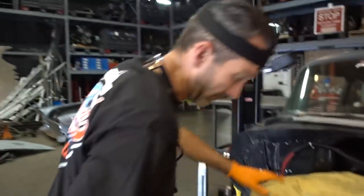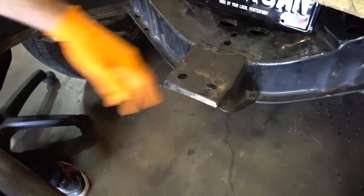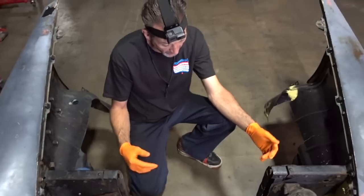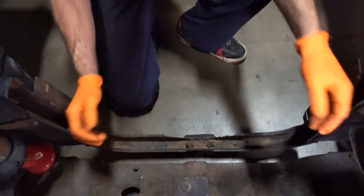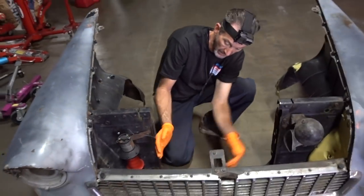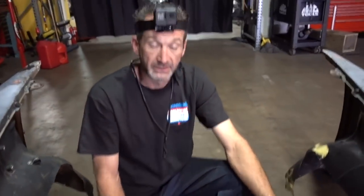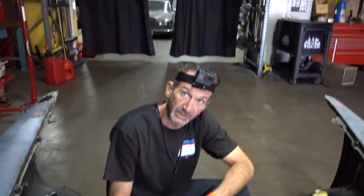So what are you doing first? Tying in the frame rails. The radiator support is going to basically go centered on these bolts. If we go over to the clip, we can walk over here and look at it. Before, the radiator was mounted on this side of those two centering bolts — these two bolts here are the two bolts we have in the frame rail. We're going to put the back of the radiator face with these bolts, so we're actually going to move the radiator forward. Then we have another cooler that needs to get mounted up here — it just so happens to be a certain size. Radiator support first and then somehow figure out how to float the cooler up into the grill area. That's going to be the major portion of today — we need to mock up all the accessories so we have all the Legos in order and get our Lego project together.